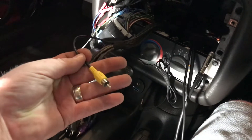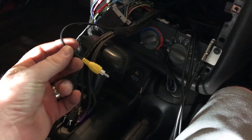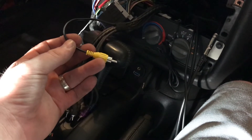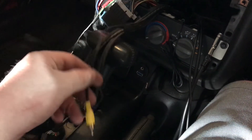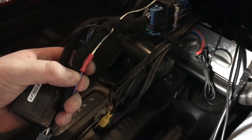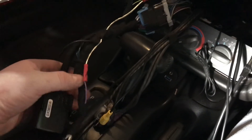We've got our video wire run and we're going to get that plugged into the Pioneer. The Pioneer camera input for the reverse camera is brown — it's the brown RCA input. It may differ depending on the make and model of your radio, so keep that in mind. For the trigger wire, remember that purple-white wire — which also may differ on your radio, but for Pioneer it's purple-white. We just extended that.